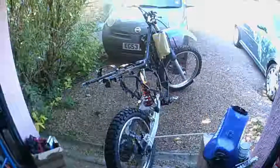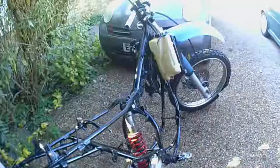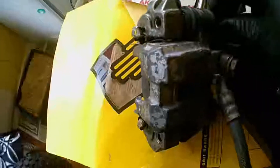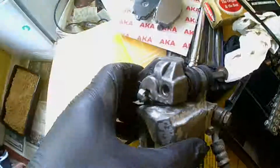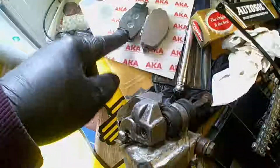It's evident that the front brake is on wrong because it's binding. The suspension works though — I've just got to get rid of the cable tie. I'm now removing the union bolt here and the caliper will hopefully split in two, so I can have a look at how the clips interact with the brake pads.